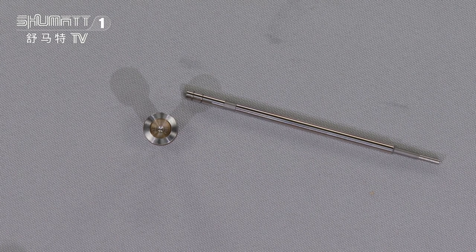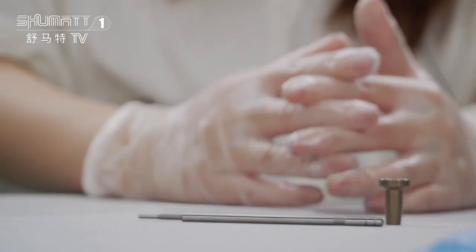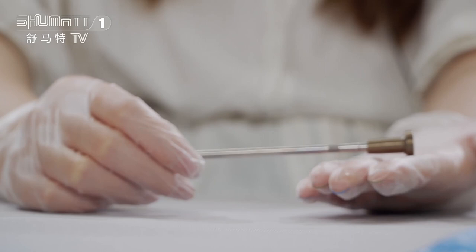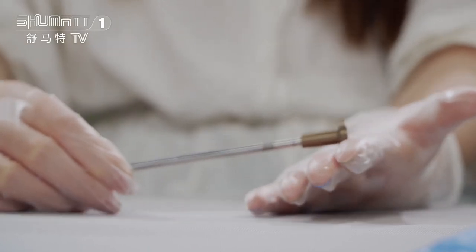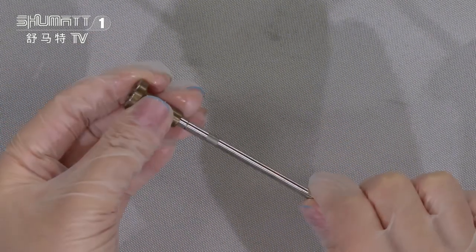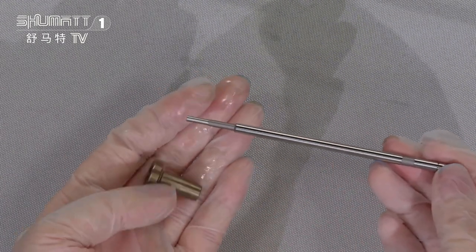Caitlin has several tips to share. We've been doing this kind of business for many years, and we not only sell products but also want to share experience with our customers. The first tip is: if you want to clean this kind of valve assembly, clean it with oil — don't clean it with water. The second tip is: if you want to install it, make sure the valve cap is in the correct position and the valve rod can move smoothly within the injector body.